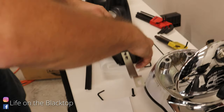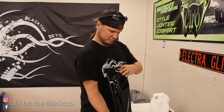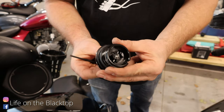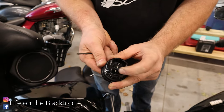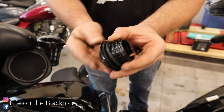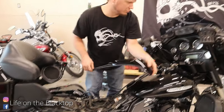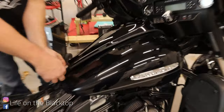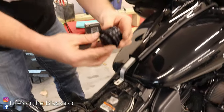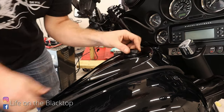Then let's put our gasket on it. Looks good. So all we have left is the bolt and our gas cap. This gas cap works like this: you push it down and turn it and then it's flush. When you release it, you push it down and turn it, those tabs go up and then you can grab it and unscrew it. We're going to put it up here, make sure all your wires are tucked underneath and out of the way, then put the center bolt in — that'll allow us to center this where it needs to be.